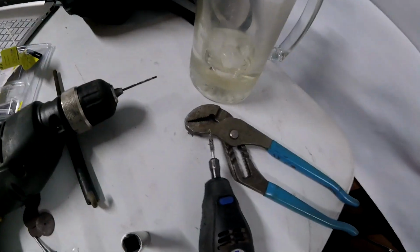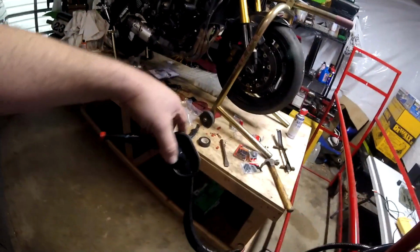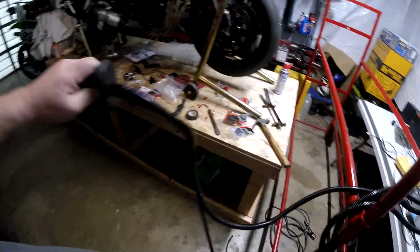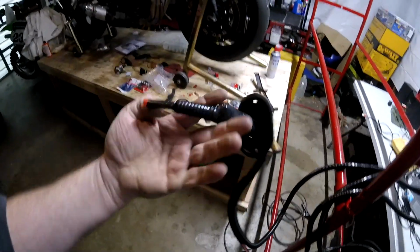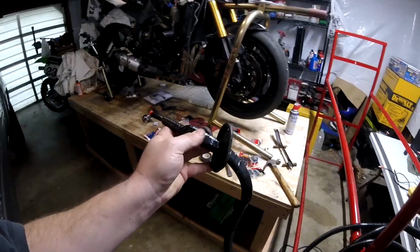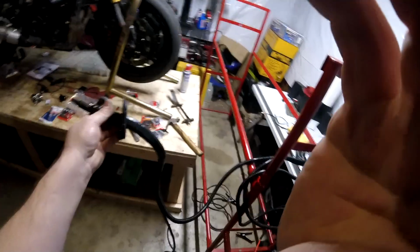Okay guys, I used that little abrasive tip to trim that plastic out in the shape of that cable. It doesn't have to be perfectly waterproof, there's vent holes anyway, it's not a big deal. Rainwater and salt and spray is going to get all up under the bottom of these wires anyway, and that's another reason I put the jacket on it. But I wanted to show you how I loomed it. The positive cable is there. It just has electric tape on it to hold the sheathing when I pull it up through the back of the truck. Then the negative cable's there, and then I pull it through. It's going to be more like this.